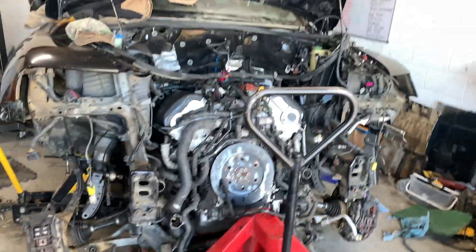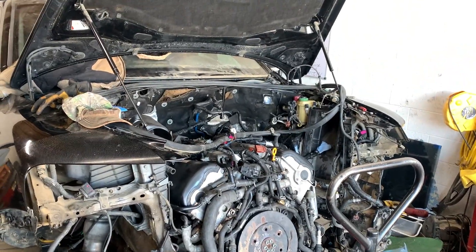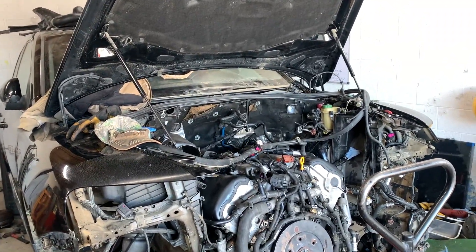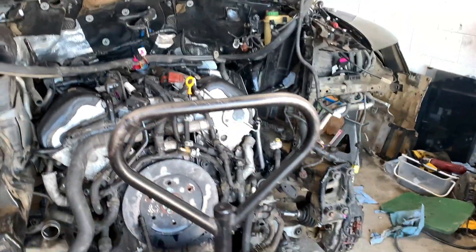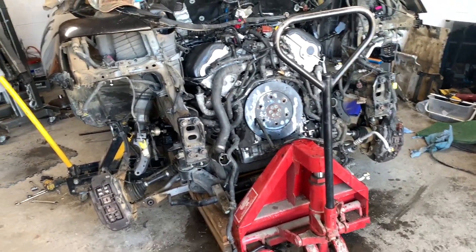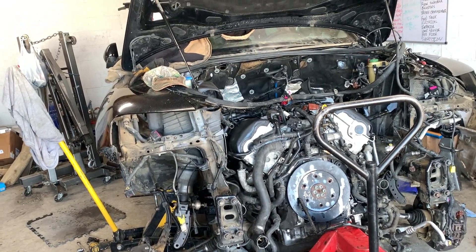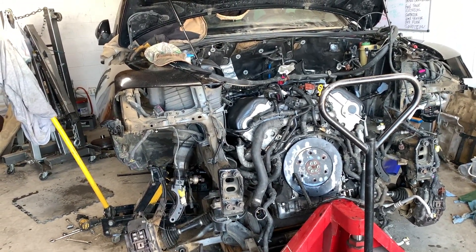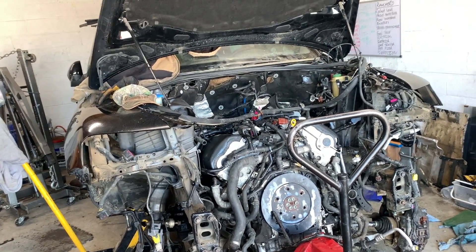Power steering is figured out. I rerouted some of the wiring on the back of the engine harness because it was a little tight - I had it routed the wrong way below a bracket. Now it sits on top and looks a lot better. I've got it rolled underneath the car and I'm going to need to put a jack underneath the transfer case to lift it above the exhaust and get it lined up. First thing is to stab the driveline - it's got about an inch and a half stub coming off it. If you're not careful you'll be fighting it.